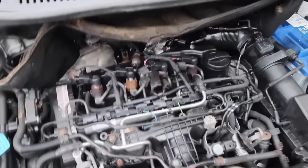I think that's enough for this week. Some great news — we've got the van started. I'm pretty sure now what the issue is. When I check the oil level, it is above the maximum. That van has got way too much oil — it's basically bursting through the combustion chamber. And the smoke that came out, believe me, if this van was auditioning for a James Bond movie it would have passed straight away. The van is just overfilled with oil, and it's blocked off the entire exhaust system. That's why when it started, it then stopped — there was nowhere for the exhaust to go, it just backed up.